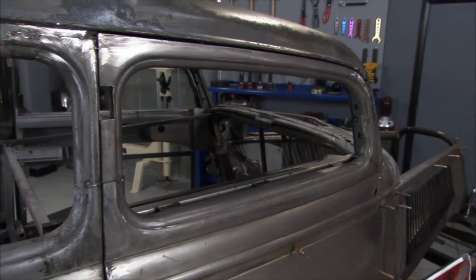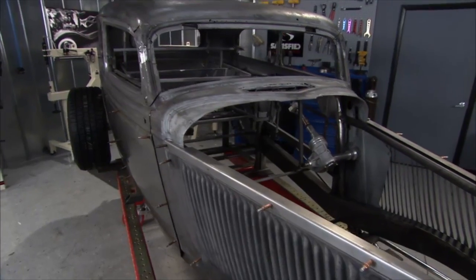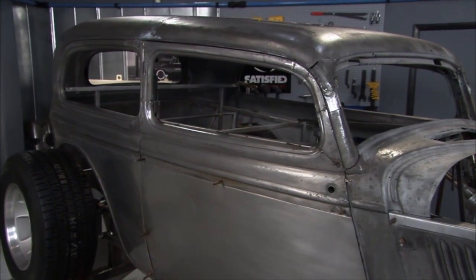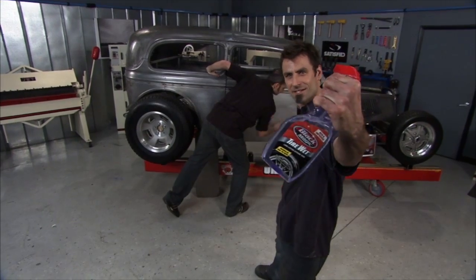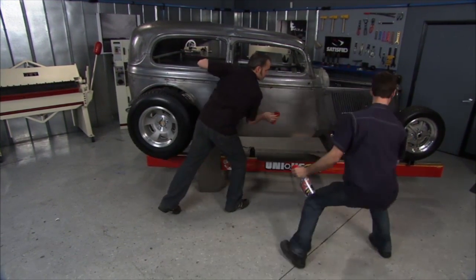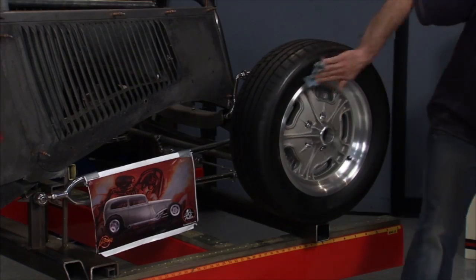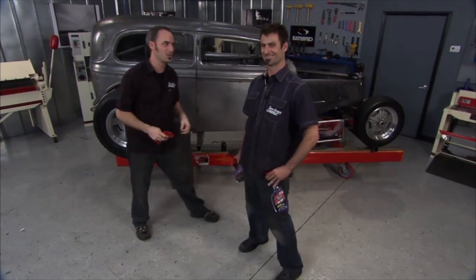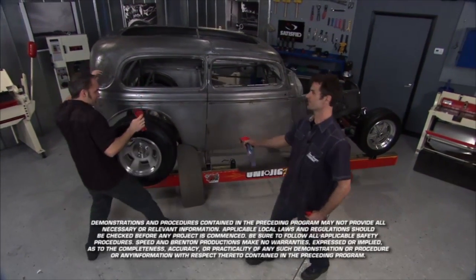Now a lot of people ask us, how do we keep these things in bare metal? What we use is phosphoric acid, or metal prep. Put it on a scotch brite with some gloves because it is an acid — clean it down, get it nice and clean. And once it's clean, a little automatic transmission fluid wiped over the top will keep it from rusting and make it look good for a long time. And if you want to take it to the next level, get that Black Magic tire wet — get the tires nice and clean. People come by the shop and they'll know you mean business. Brian's such a goofball — he can't even wait for it to get out of paint to spiff it up. Well, hope you enjoyed the show today. See you next time on Two Guys Garage.